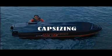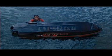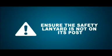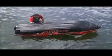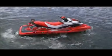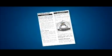In case of capsizing, to return the watercraft upright, ensure the engine is off and the safety lanyard is not on its post. Then grab the inlet grate, step on the bumper rail, and use your weight to rotate the watercraft in any direction. Consult your operator's guide for more details.